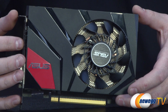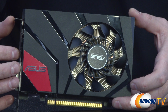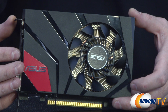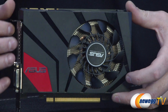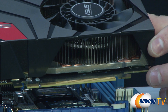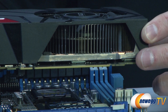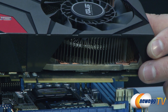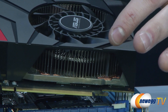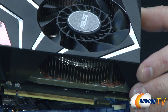The GPU boost clock is 1006 megahertz. The GDDR5 memory — two gigabytes — runs at 1502 megahertz, or 6008 megahertz effective when quad-pumped. The DirectCU cooling unit is quite innovative: there's a flat vapor chamber visible at the bottom with copper in there, which is a very wide vapor chamber covering many of the components as well as the GPU itself. On top you have the fan and a fin array in a radial design, pushing air out in all directions to keep all the componentry cool.